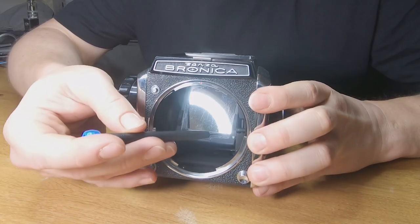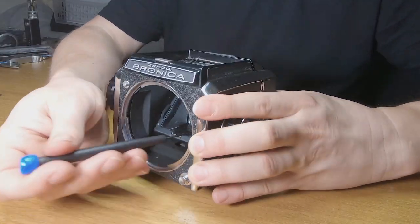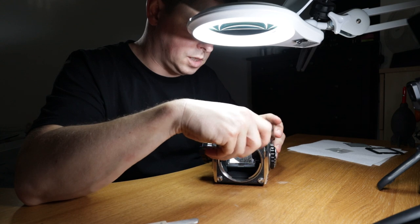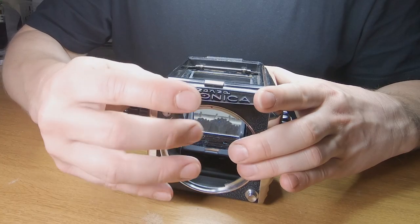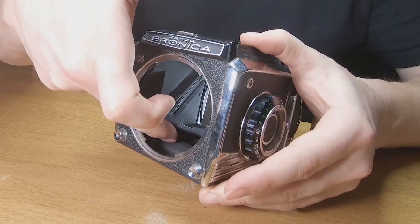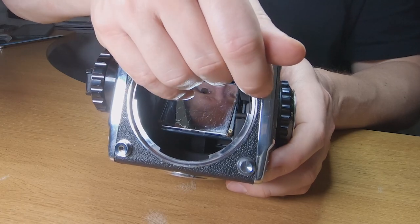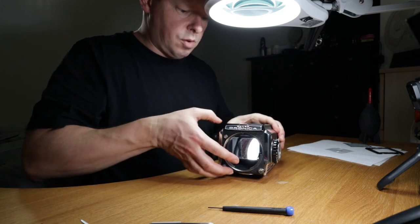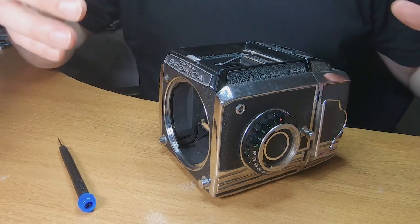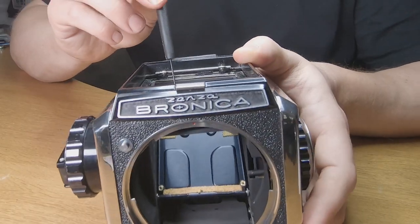Let's take a quick look under this mirror. We're going to unscrew this one and this one — you do not need to unscrew the top two. Once you've unscrewed the bottom two, that whole panel will hinge upwards and will click at the top. It's been designed for this purpose. Those are coming away pretty easily, and that one's out as well. Once those two are out, I should just lift — so the whole mirror doesn't come up, the frame comes up, and you can push that all the way to the top. Now we can lift out the mirror.